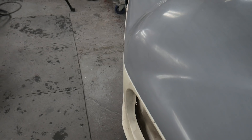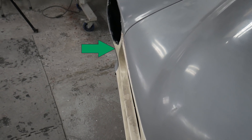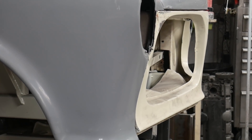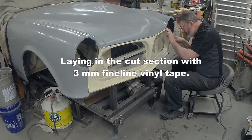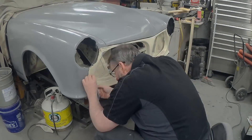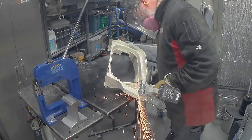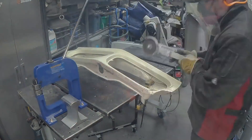Here's just a quick pan over the top edge. You can see it fits really nicely on the driver's side, but as we pan over to the passenger side — the left-hand side panel — you can see that we're off probably 3–4 mils, and that's with the headlight ring and everything in the right place. It's just a result of it getting hammered around and probably wasn't very accurately made at the start. With the carbon fiber panels, we know we're not going to move those after they're made, so you have to get out of the steel mindset that we can always hit it with a little bondo or whack it with a hammer. That's just not going to happen with these kinds of parts — they have to be perfect when the mold is made.